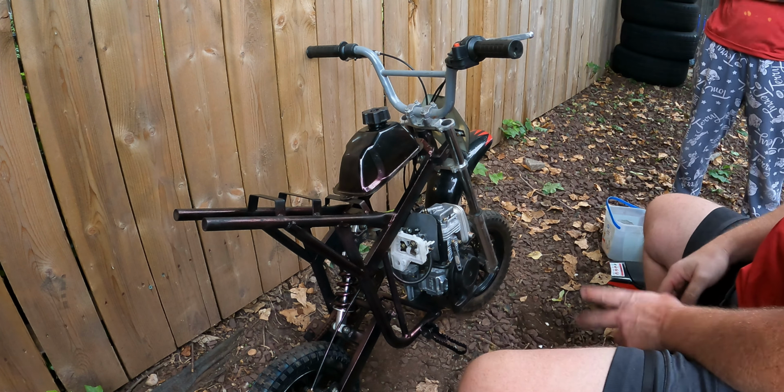So what I did, I made a custom little flat metal spring, just bent it up so that it hits that notch in the choke. It holds it in choke, doesn't wiggle. And then you flick it down and it holds it open. So it's working perfectly and I'm happy with it. Who knows, if it's running properly, we might not even need the choke. All right guys, so you see how I fixed that? Just a little homemade basic spring, really, like a little friction spring. That's everything with the carburetor. And I think it's time to put it back on and see how it goes.